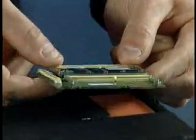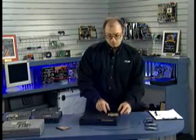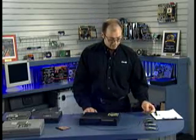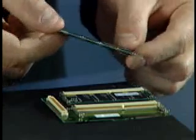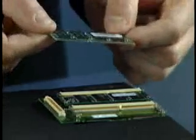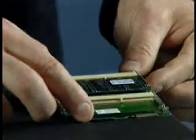What we have is a little memory card with two 144-pin SO-DIMMs on it. Prior to performing the upgrade, you need to purchase the correct memory module. Here I have a 144-pin SO-DIMM — this is EDO memory, which is the correct type for this notebook. This happens to be a 32 megabyte module that I'm going to install.